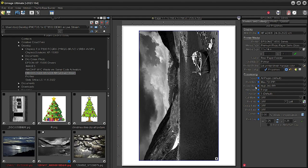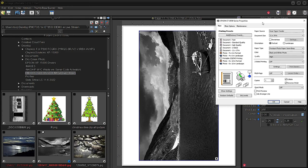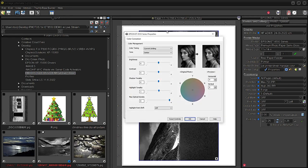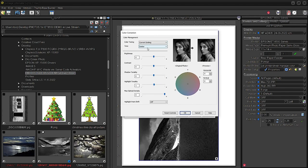Let's jump back to queue image and set the black and white mode correctly. Here we are — back to printer and settings, going into the driver itself. We're using black and white, so when you go to more options and advanced, you get different options — not the ICM and sRGB modes, but input and output controls. Notice the settings: you have to choose 'darker,' which makes absolutely zero sense at first. Watch what happens when I click 'normal' — the secondary output picture gets lighter — almost matching 'darker.' That's the match.